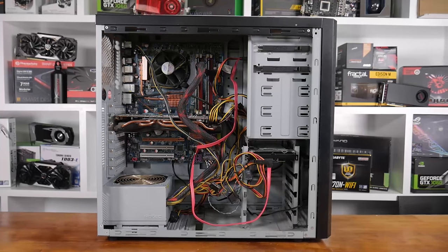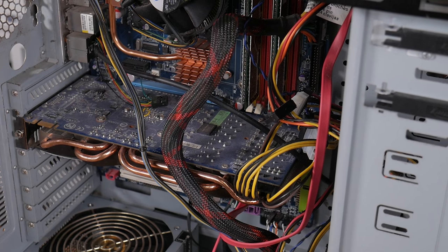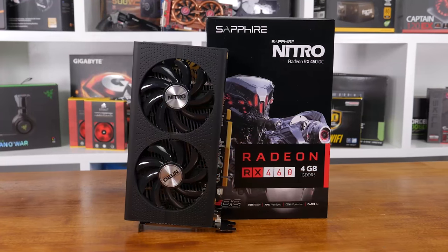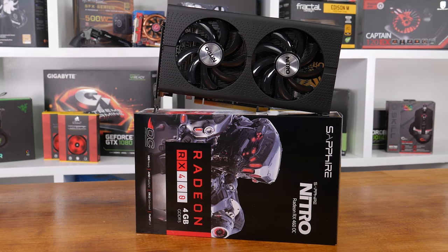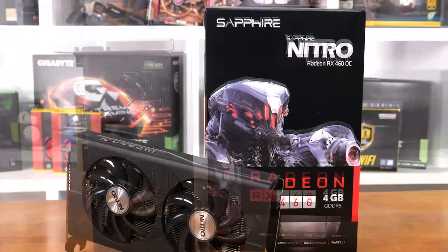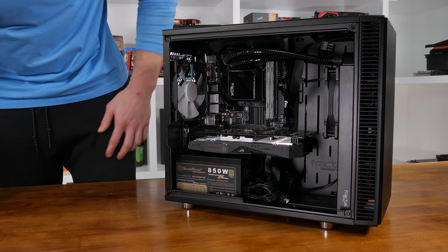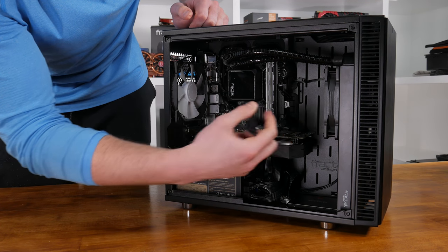This is what I wanted to find out, so I picked up half a dozen popular games including Star Wars Battlefront, League of Legends, Overwatch, Counter-Strike Global Offensive, Dota 2, and the ever popular Rocket League. The Core 2 Quad Q9300 system with the GeForce GTX 560 Ti was tested in the condition I received it in to see what kind of results were achievable without any upgrades. The GTX 560 Ti was then swapped out for the recently released Radeon RX 460 to see what headroom there was in the processor, and we also overclocked the Q9300 to 3.25GHz.